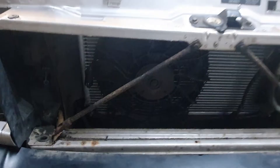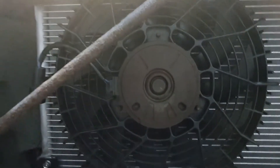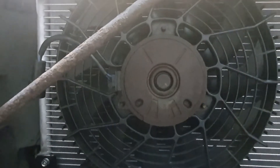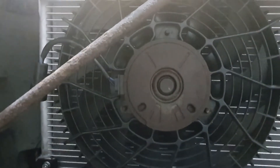Finally got the Araldite in paste form. Inside this, two of the magnets had fallen off — one of them was disintegrating and jamming up the fan. So I've glued the magnets back in, what remained of one of them, cleaned the commutator up and fitted it all back together. And it runs really nicely. So that's ready to go.